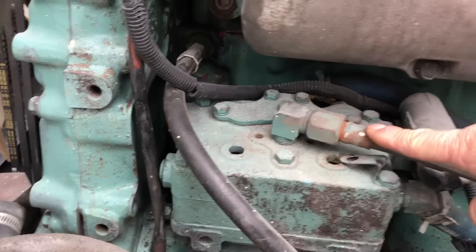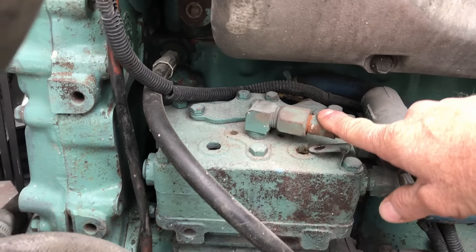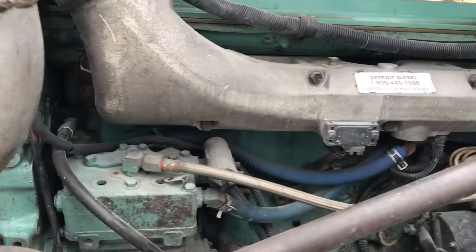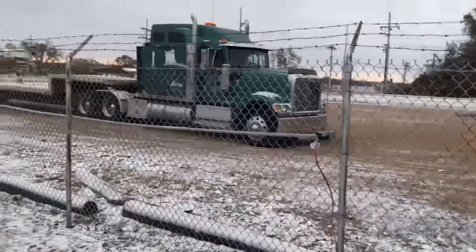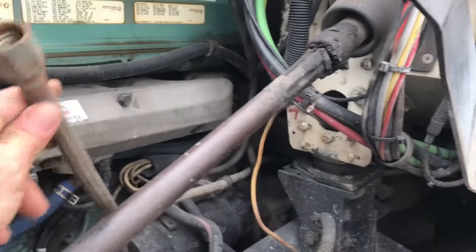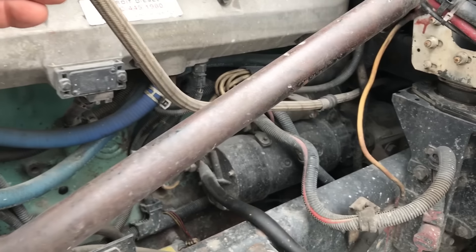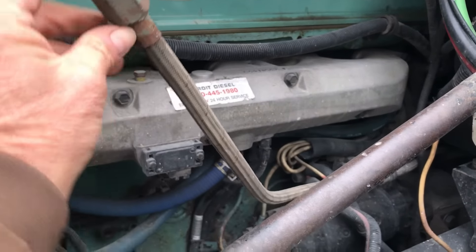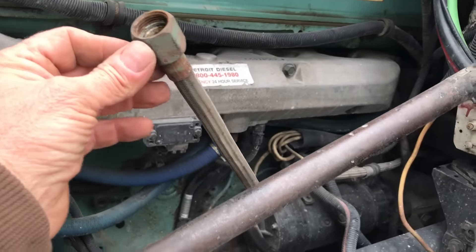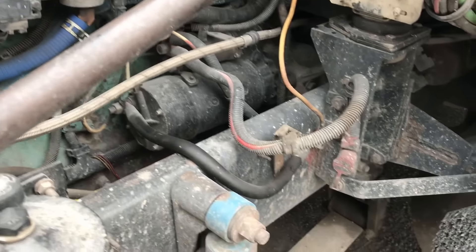That is the air hose I need to take off the compressor and pour alcohol in. I don't even have a wrench in my truck to fit that, so I have to borrow one from the shop. That's not my engine you hear running in the background — that's another truck over here. Got this line off. I'm going to hold it up and pour alcohol from this bottle into the airline. If I was at my own shop at home, I'd stick an air hose with a rubber tip in here and force it through, but that's not an option. So I just pour it in there, hook it back up, start up the motor, take it back off, and do it again three or four times.